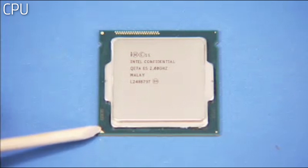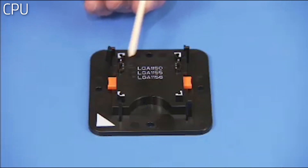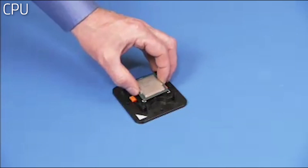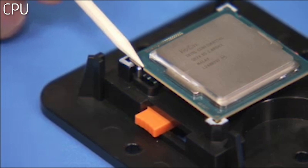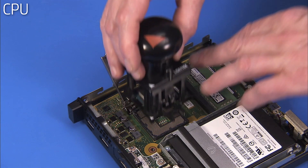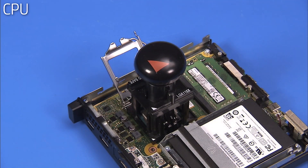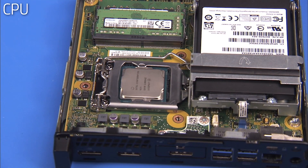To replace the CPU, first identify pin 1 position on the microprocessor by noting the yellow mark on the corner of the chip assembly. Make sure the Intel CPU staging tool side pins are set to the correct socket type for the CPU. For this unit, it is LGA1151. Place the CPU into the Intel CPU staging tool. When correctly inserted, the small notches on the side of the CPU should align over the side pins on the staging tool. Place the removal replacement tool over the stage, lining up the pin 1 triangles on each tool. Press down on the removal replacement tool to pick the CPU up from the stage. Align the removal replacement tool again to pin 1 on the motherboard CPU socket. Press the plunger on the removal replacement tool to release the CPU into the socket. Swing the load plate down. Lock the load lever under its retaining tab to secure the microprocessor into place.